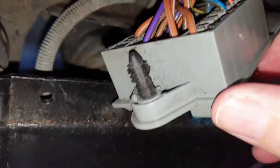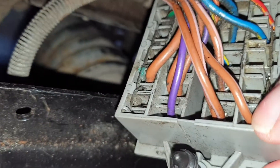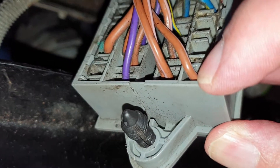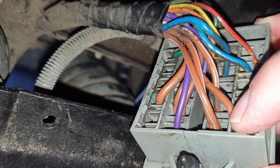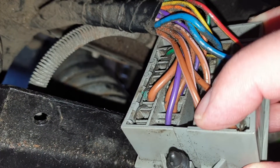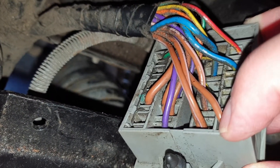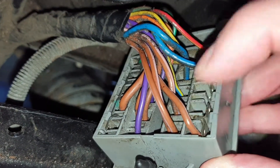Get the bike running again and put the probe in the back of the connector. When I put my probe in the back here, I had the full voltage coming out on one side — that side flowing in — and a voltage drop on the other side flowing out to the battery. I checked the fuse, pulled it out and swapped it — no difference. So the problem was definitely in the back of this connector.